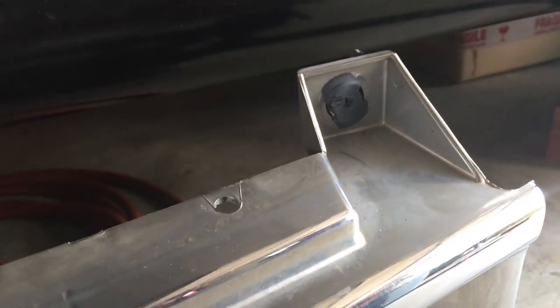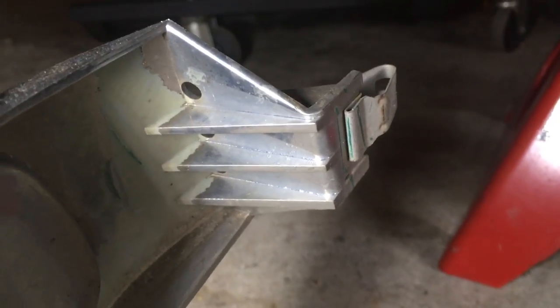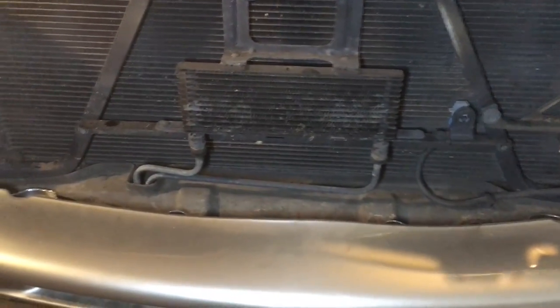The second clip — there are two more on the bottom. Also be careful not to pry it away too hard because on each side are retaining clips, so you have to pull it out carefully. So six things holding this on, and once you get it off you've got good access to the transcooler.